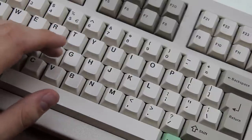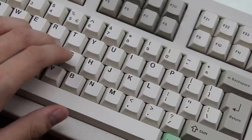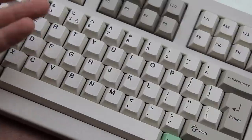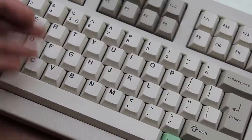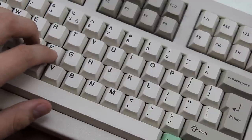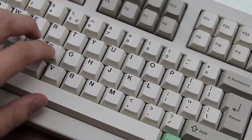The result of these two is, first of all, that the tactile bump doesn't actually feel more pronounced than that of MX Brown, in my opinion. Different, maybe, but not explicitly stronger the way, for example, a Matias Quiet Switch or Box Royal would. The tactile drop is overall bigger, but is more drawn out and the stiff weighting partly obscures it.